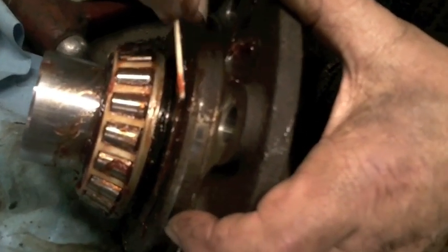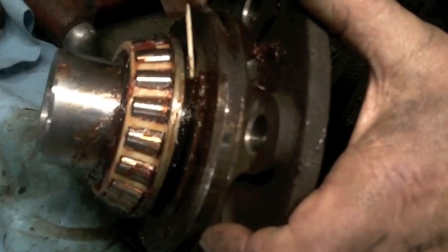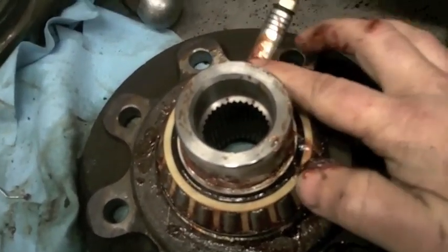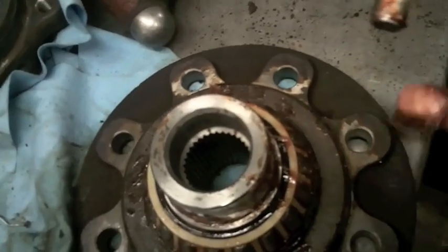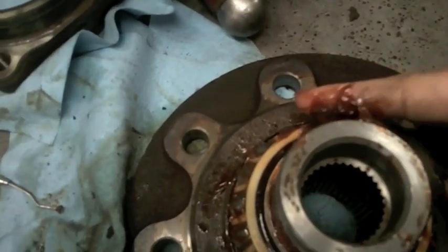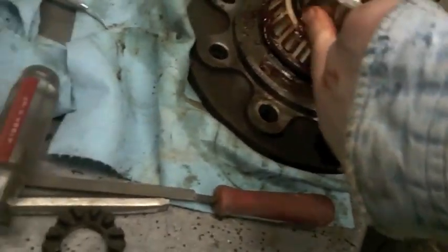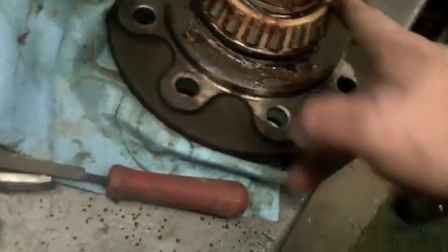Yeah, getting a little bit of dirt too. And on the face of them, right along in that area. So then when we put it together — the factory grease on my wheel bearings, I swear it was all just brick in there. Didn't make it 30,000 miles and they were shot, all of them. It's amazing. I repack them and they last 90,000 miles. I wonder why. It has anything to do with the amount of grease I use.